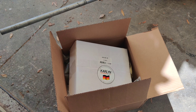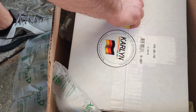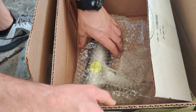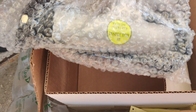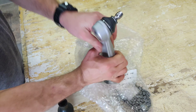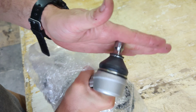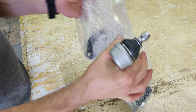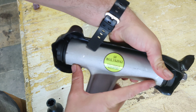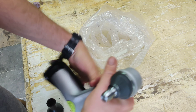Let me open up the box — I'm going to show you something Vito taught me that we're going to do before installing this. So I've got the control arm laid out on the table. This is the part that went bad on ours. When I pull it off I'll show you, but I'm pretty sure it's going to move very freely, and that's why we're getting a ton of wheel play. You've also got bushings in this area that can dry rot and wear out, so it's good to change out the entire thing — especially at $73 for a good quality one.